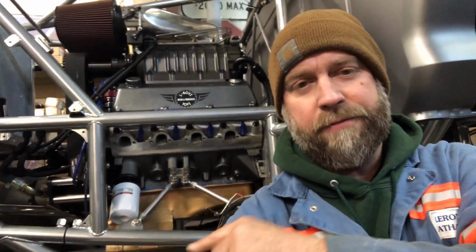Now, most of the adapters that I have seen, they actually face one side of the adapter and put a bit of a taper to it or an angle on it, and they match the difference in angles between the big block Ford and the big block Chevy. Now, the problem that I have is the material that I had on hand is not quite thick enough. I can put the difference in the angle in there, but I cannot space it out far enough to still clear the tube of this chassis right here and my header. So I have a couple of options.